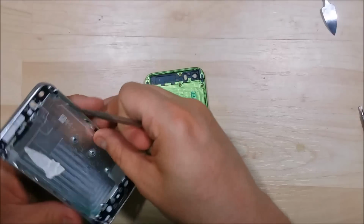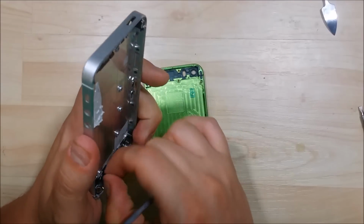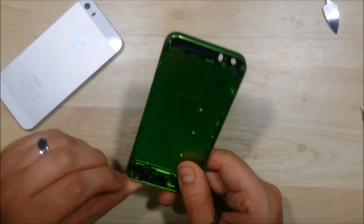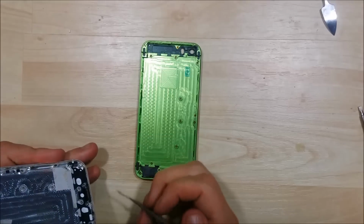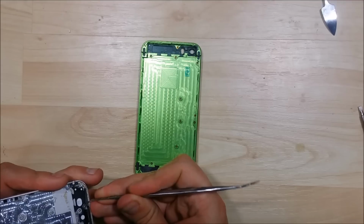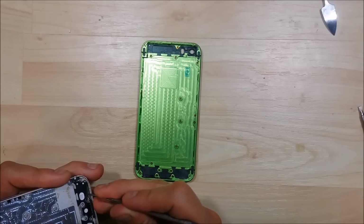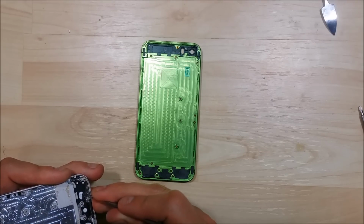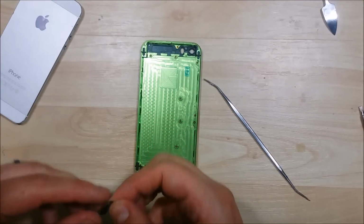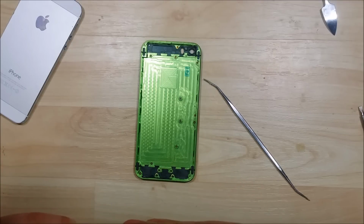We're just going to look at the device and see if there's anything in this one we want to transfer over. Just the little grates down here at the bottom for the speaker, the microphone area. Just going to transfer these little dust caps over, and a little rubber grommet from this side. Make sure that everything is 100% perfect once we start to reassemble this device. Be nice and gentle as you're prying these out, as they are easy to rip. You can go ahead and transfer this into the new portion on the bottom side of the phone. Try to clean it out a little bit. This is a dust cover, so it does catch a little bit of dust as well.